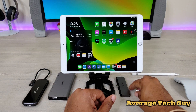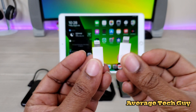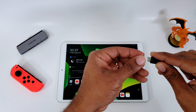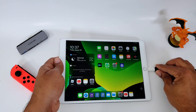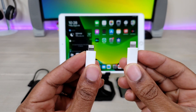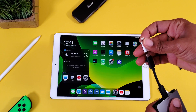I wanted to talk about these pieces right here that I picked up on Amazon. These are basically supposed to let you connect any peripheral devices to the iPad through USB Type-C. I've been working with these trying to get them to work. Power pass-through will work — you can plug this Lightning adapter into your iPad and get power — but you cannot plug this in and make it work with your USB Type-C hubs.